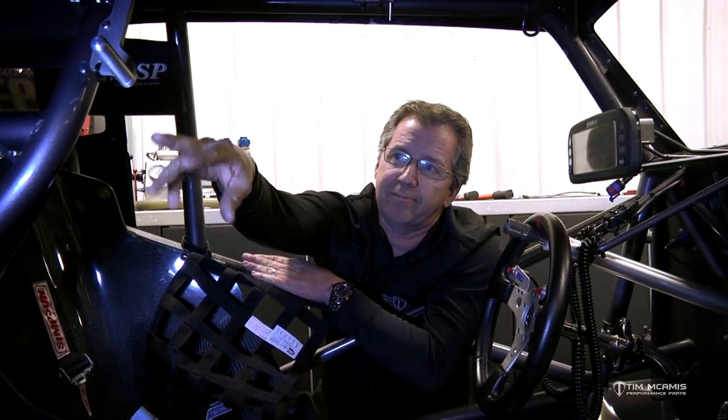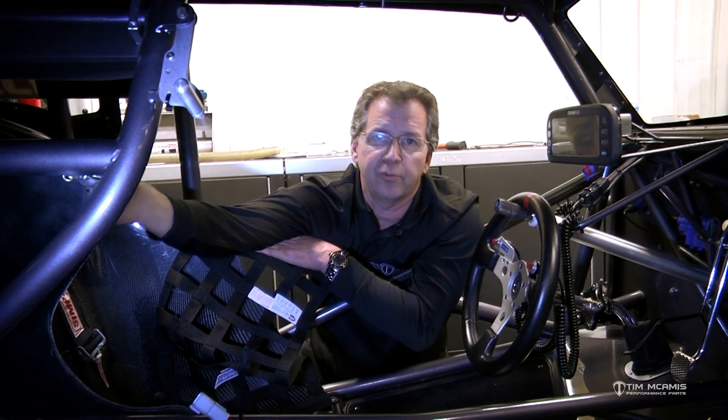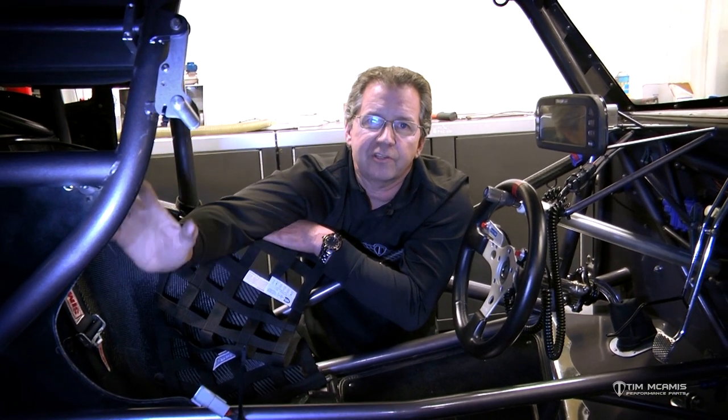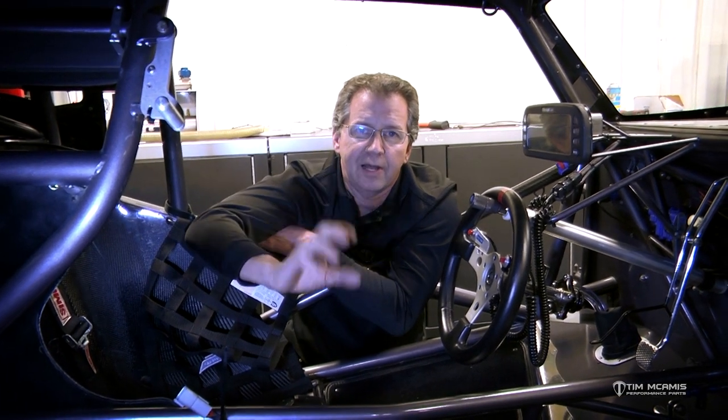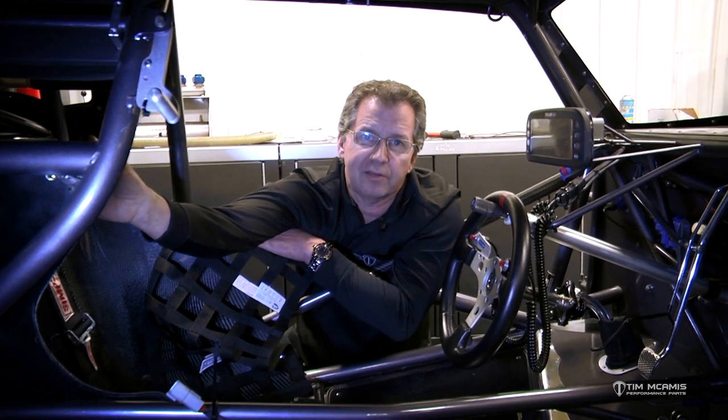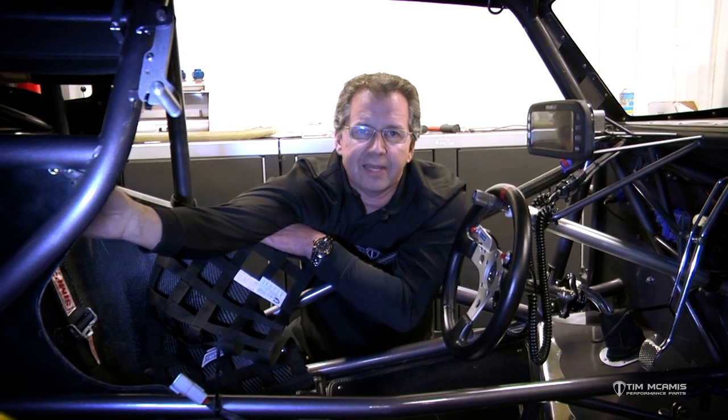While we're doing this, we're doing some other service work on the car, and part of our standard maintenance is to check the fire bottle cables and the fire bottles. Guess what? The fire bottles were in the car with no pressure — they were junk. Both gauges in the red. Who knows how long they've been like that? You guys have to seriously check this. It's not the time to figure out when you're on fire that your handle is zip tied, and even if you muster enough strength to break the zip tie, you don't get anything out of empty fire bottles. You get your ass burnt up.